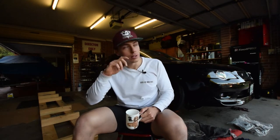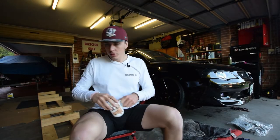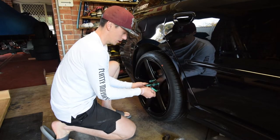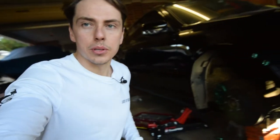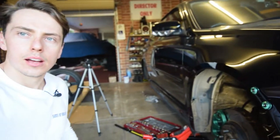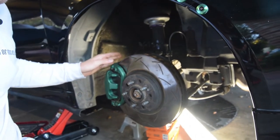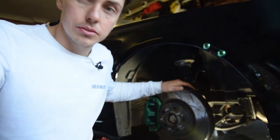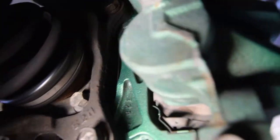Let's get the wheels off the car. We're running out of daylight; we'll see if we can knock this over relatively quickly. Let's go. So we have got the wheels off now. That is the front, and the back is also off. So we're going to have to take this rotor off, take this caliper off, and then test the rotor and the caliper — basically test if it fits. To do that, we are just going to have to crack this nut here and then this one.